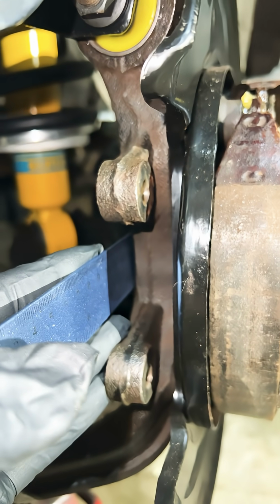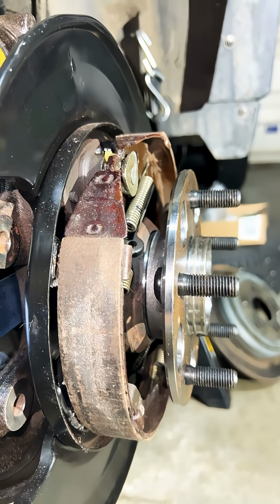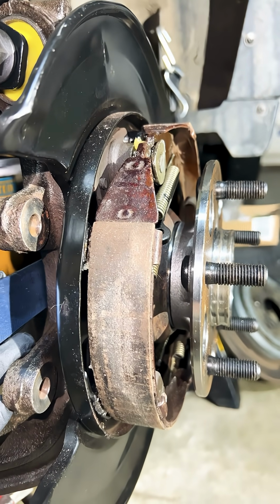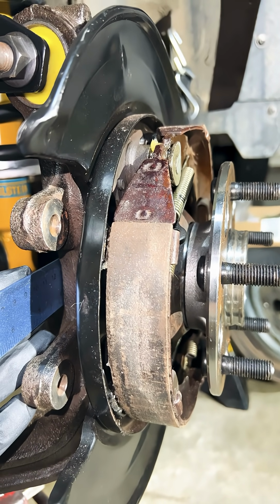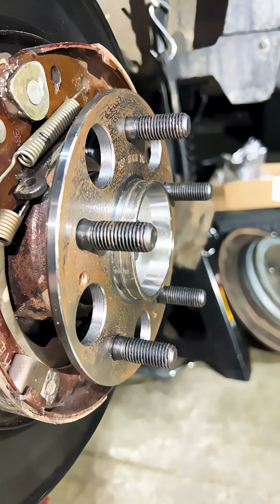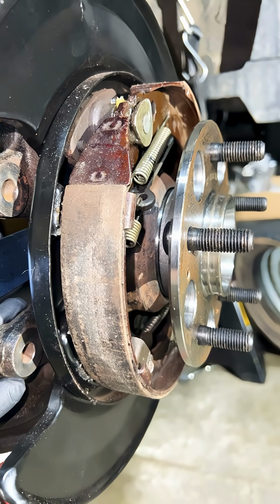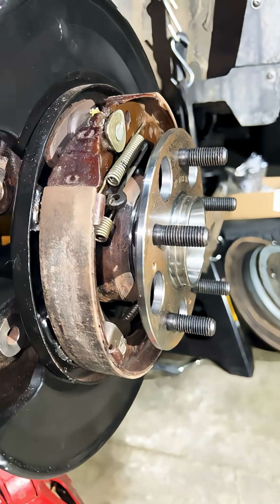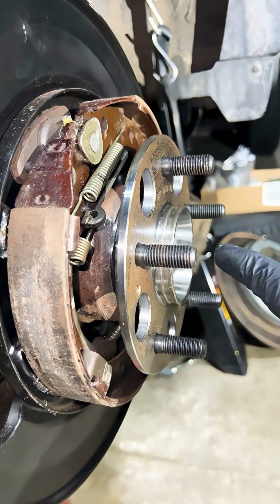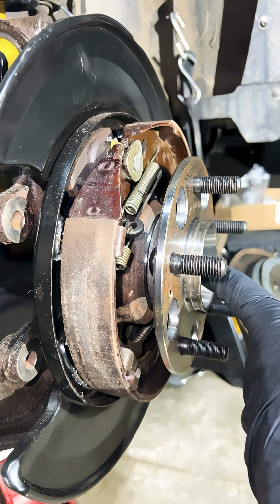I think I've already measured from the back of the bearing to the front of the hub and gotten exactly the same thing. I'm going to measure again like this, with a popsicle stick across the front, and get an exact reading on both sides. And then after that, I think I'm going to put the bolt press together again.